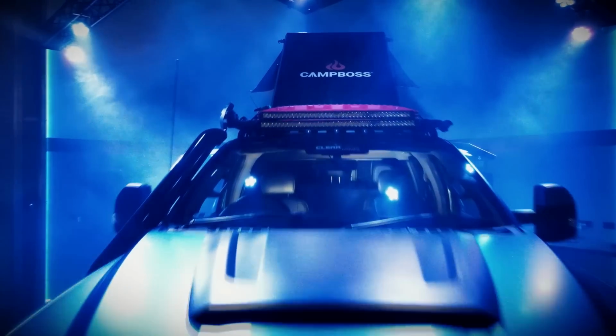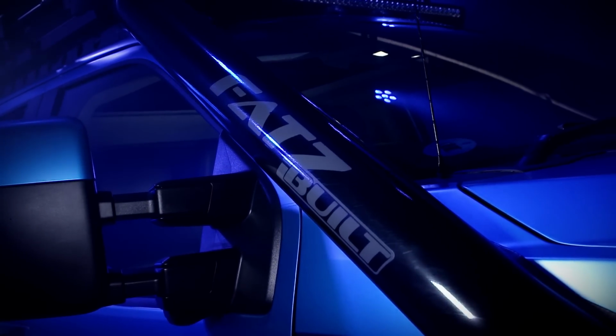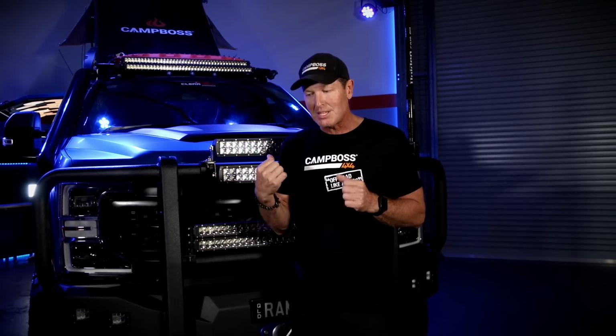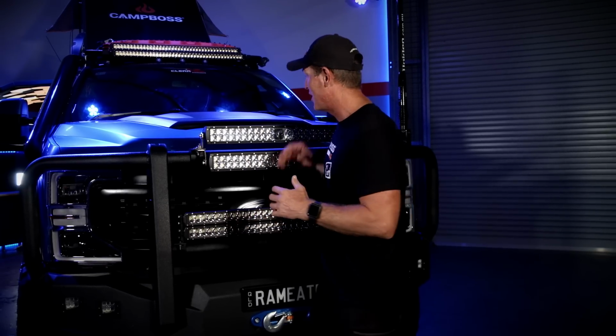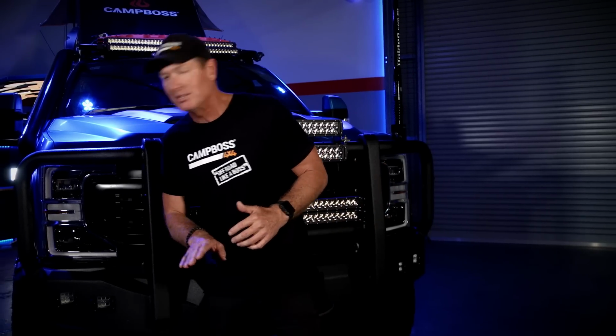And of course, don't forget the snorkel. This thing's got to breathe. It's a 5-inch tube snorkel, like a pipe snorkel, and it goes into the air box, which is the original air box under the bonnet. Now the thing has to breathe, there's no doubt about it. 6.7 litre turbocharged V8 diesel. It needs a lot of air. And I don't want to get caught on creek crossings, even though I can literally be doing about a 1.2 to 1.3 metre water depth, and if you have a look there, I might get a bit of water on top of the tyres. It's insane to think that, but this height is nuts.